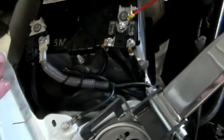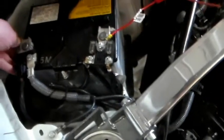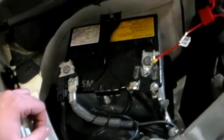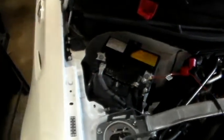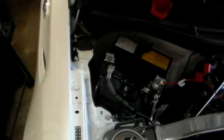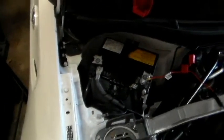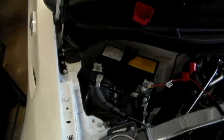Next I've got to deactivate the power supply off the ground end. We've got to remove this battery terminal so we don't have any grounding issues, and then we can start feeding everything through. That looks like it's going to be a 10-millimeter. I'm going to take the 10-millimeter wrench from my tool chest and we're going to start feeding everything into where it needs to go.